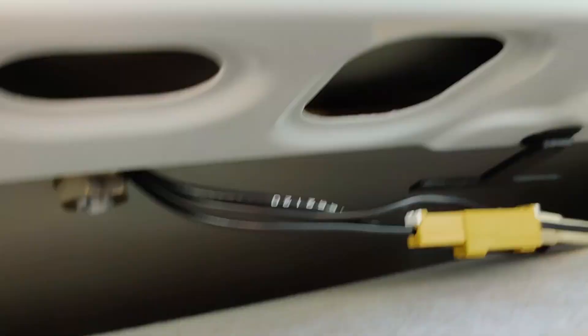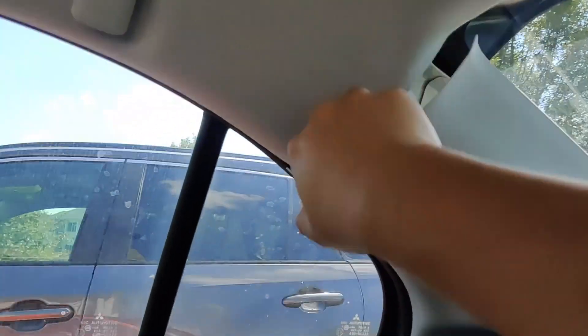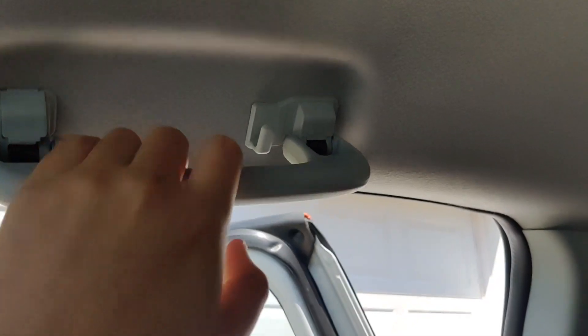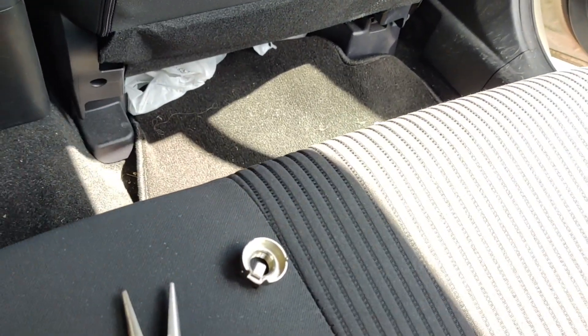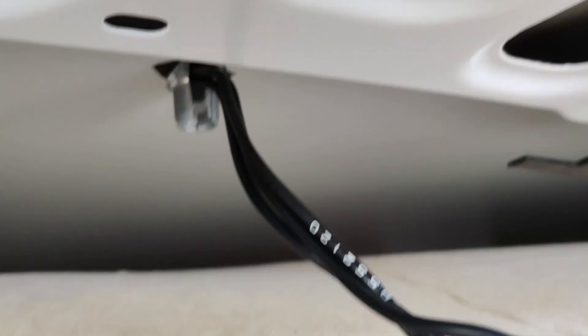You can see there's the plug, and somewhere in there is the nut. What I usually do is reach the plug with my hand and then use a set of pliers to get to the nut. Pull the C-pillar down like that, and that gives you enough access. I got the nut off — it's pretty hot today, around 90 degrees, so it's really hot to hold. I unplugged the three wires and then I could slide out the antenna from the outside.